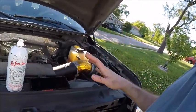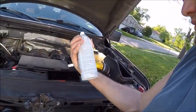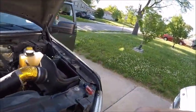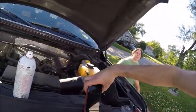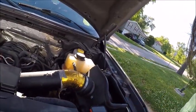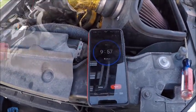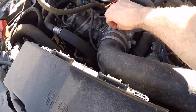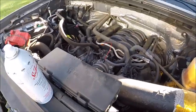After you've done this, you've got to let it sit for about 10 minutes and let all the seafoam soak into all the nooks and crannies. One last thing — go ahead and take this tube out and put your air intake back on, which I'm going to do right now.